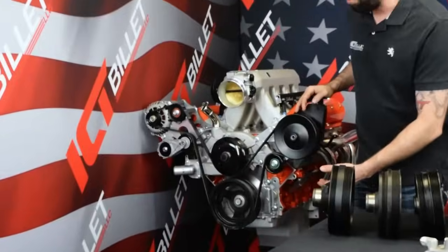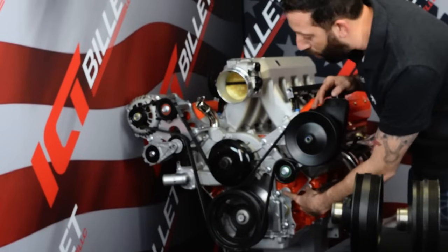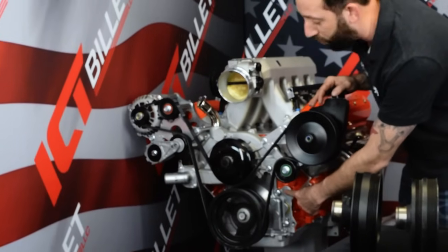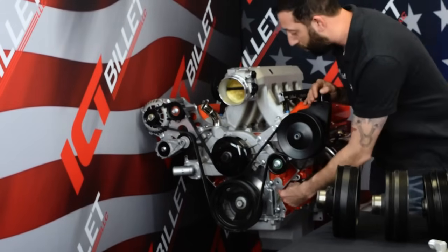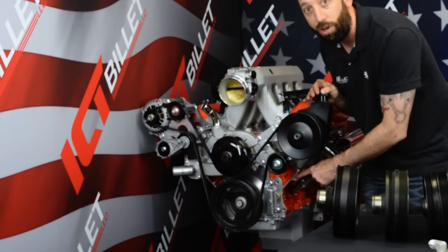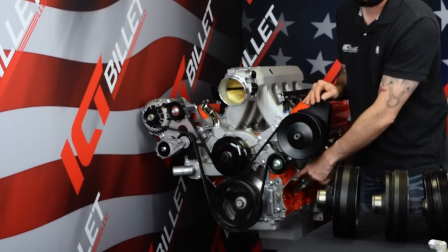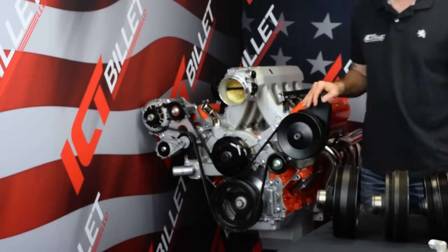Let's look at this aluminum block here. You'll see that it's got two holes here for the accessory brackets. These are not present on any of the steel block engines, on trucks, SUVs, and other vehicles that came with a steel engine block. You won't be able to use this on a truck block that doesn't have it, but this area will be there on the trucks. You can use a drill template and actually drill this out to an M10 1.5 hole, and that'll allow you to get accessories down there.